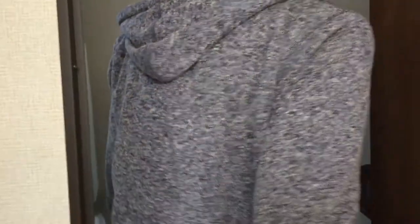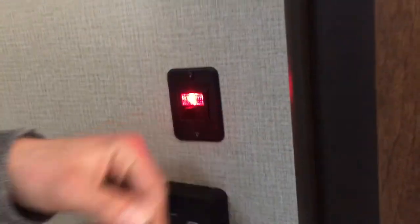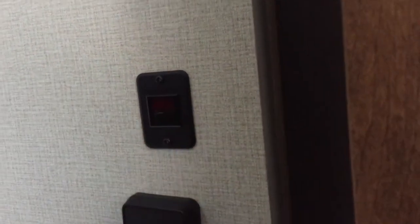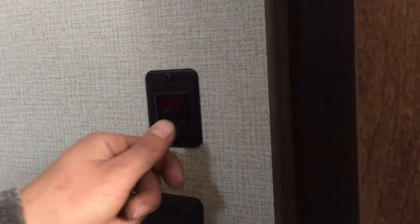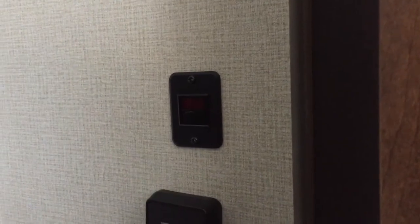For your bunks, you've got lights up on the walls as well as USB outlets for charging phones and so on. Into the bathroom, you've got your hot water tank control right up on the wall. Turn it over to the right and it fires up. That light comes on to let you know it's supposed to be turning on; if it comes back on, it's letting you know it hasn't lit. Same as with your fridge — just turn it off and back on to reset it, and again if it doesn't go, just check your propane.